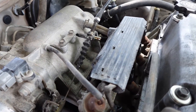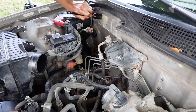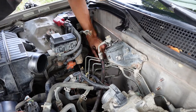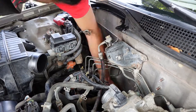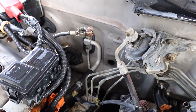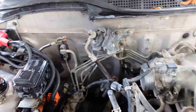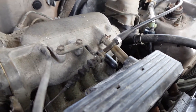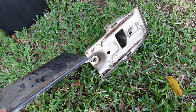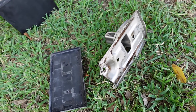I'm going to place a vacuum cap on the intake manifold so we don't have a vacuum leak. Everything is clean back here — got rid of a couple of wasp nests and a lot of dirt from inside that corner, so it's a lot better up in here. I've got the vacuum cap where that vent hose was going into on the intake manifold, and I already cleaned up the battery tray, so I'm going to be sticking the tray and battery back on.